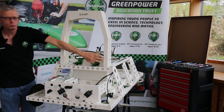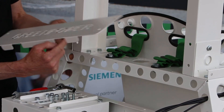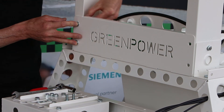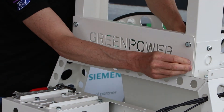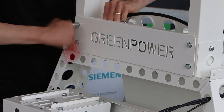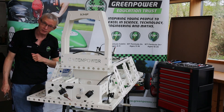The final part of our roll protection system is what we call the green power panel. This has a cutout at the bottom that sits around the safety harness flanges and fits onto the four holes at the bottom of the roll hoop. Put the bolts through to hold those in place, then pick up a washer and nut, and using the same tools as for the roll hoop fastenings — 13mm socket and spanner — tighten those up. And that's the end of this video. If you need any further assistance with the green power project please feel free to email or call the office.